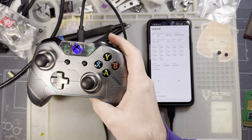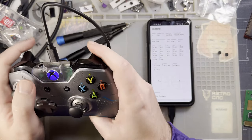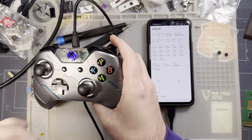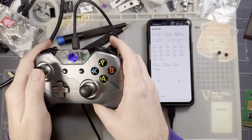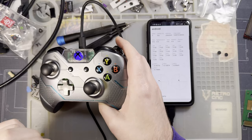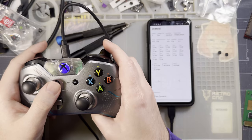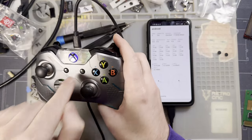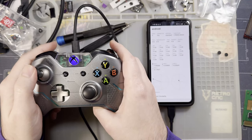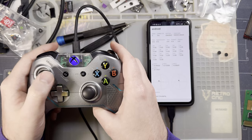As it turns out, I have learned some things since I did that original video, and maybe you guys don't know that either, but I certainly didn't at the time. These controllers are calibrated from the factory to the specific joysticks that they come with. So something that I should have done was save both the sticks and then reuse the potentiometers in the replacements. Then I wouldn't have had to calibrate it. There is, to my knowledge, no way of calibrating it at the firmware level to fix that. You can calibrate it within the operating system itself, and that tends to address the issue, but that doesn't really solve my problem here,